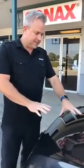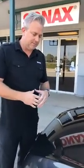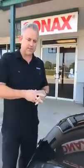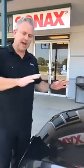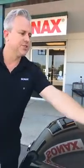the protection on it. So again, with sealants, the nice part is the longevity that they last, and the amount of heat that they'll withstand. Over 300 degrees heat with sealants, waxes about 160. So your longevity, the ability to hold up in harsh conditions, sunlight, hot panels, things like that, is much higher with a sealant. So I'll just show you really quickly.